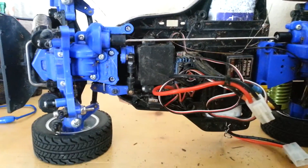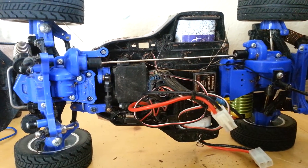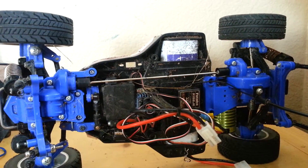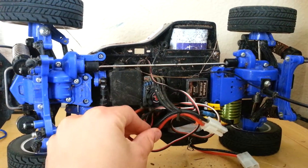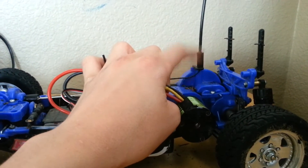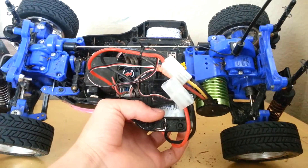For electronics, I've done a standard Futaba servo, a Tower Hobbies — or Simon — brand, kind of a hole-in-the-wall brand that manufactures toy grade RCs, with fairly okay six-cell packs. I stuck one of those in there. I'd kind of like to run LiPo, but I don't really want to grind out the battery case. I have the standard Futaba 27 MHz two-channel, a Hobbywing 35 amp ESC, and the Tac-On 13-turn 3000 KV brushless motor. But the gears are so cheap in this that one burst of throttle strips the gears — I've gone through about 10 to 13 gear sets in this easily.